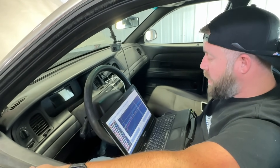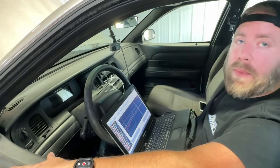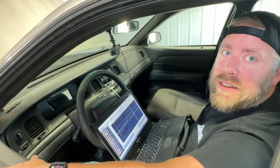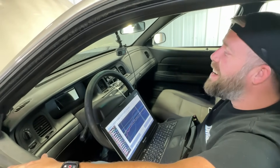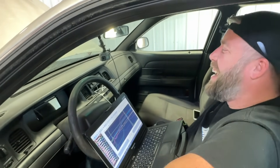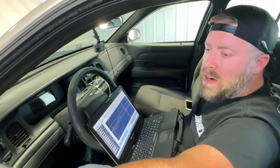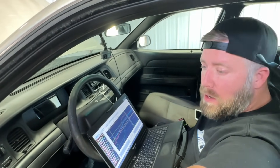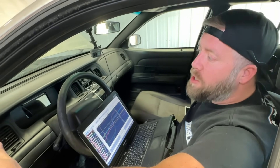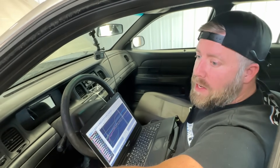Everything looks good. We'll try to pin the gate — stick it at 100 percent and whatever it makes, it makes. Maybe we can get it to cross that 750 mark. We could pull the air filter to see what difference it makes, but I'm not looking for records and I don't feel like putting head gaskets in this thing today. It's super cool to have such a wide range of boost — from an 8-pound spring all the way up to maxing out the MAP sensor. We're seeing three times wastegate spring, which is solid. Typically you only see two times. And on the street we were seeing about a pound and a half more than on the dyno, so we may actually see 25-26 pounds out there.